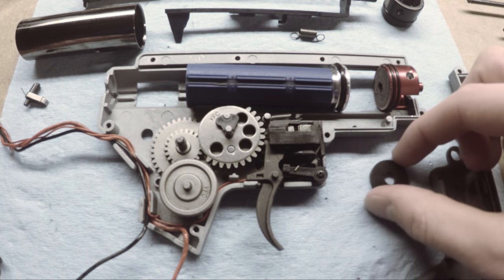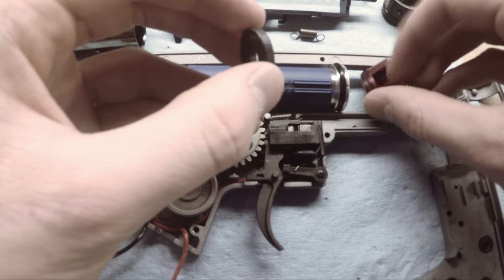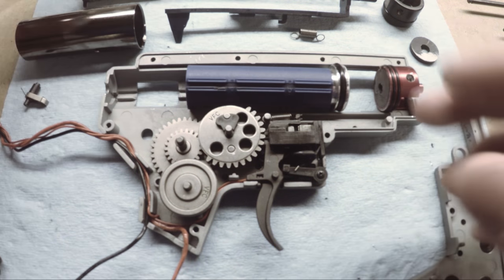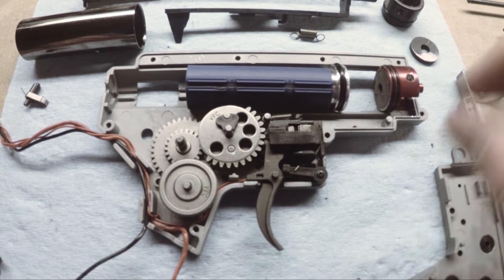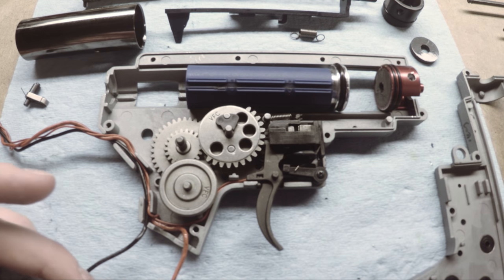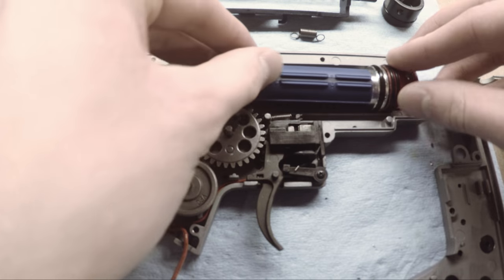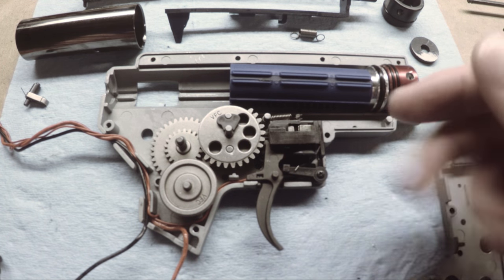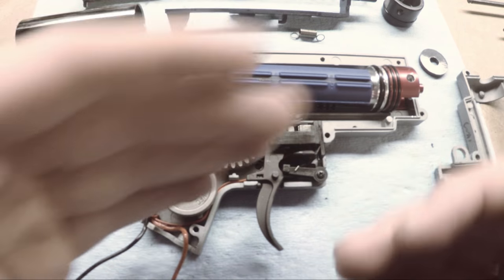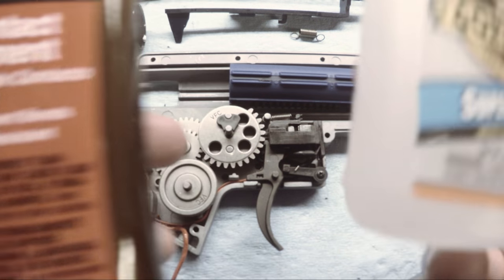There are a variety of attachment methods for putting this to the cylinder head, and I found the best way is to use some sort of adhesive — something like super glue or contact cement. I've heard of people using epoxy, which I find to be a very bad choice. Epoxy forms a very hard resin, and things that are hard tend to be brittle and crack or break up easily after repeated hard impacts. What you want ideally is an adhesive that forms a flexible bond between the two surfaces and gives and takes a little when it comes under impact. For that reason my two choices are contact cement or super glue.